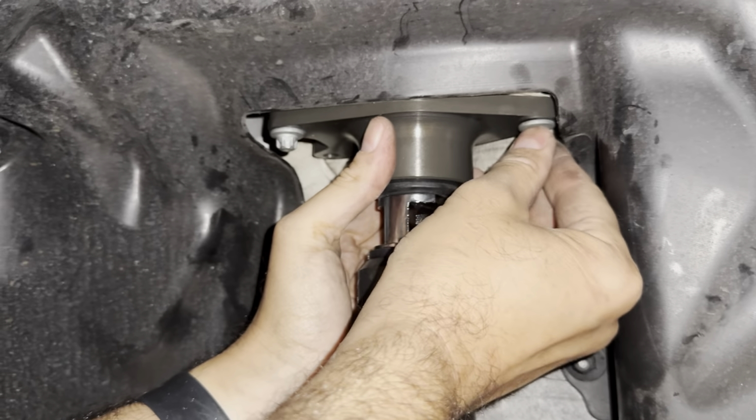So what we're going to do, we're going to jack this up till the car starts to move. Right now, arbitrary point, we're going to do that at, let's call that 52. So 5 centimeters less than that will be 47. So we're going to start lifting it up. And hopefully at 47, it starts to get lifted off the jack stand, or about to. All right, up we go.